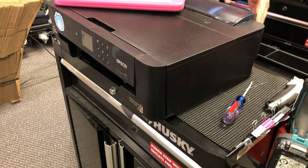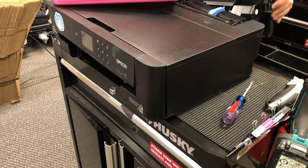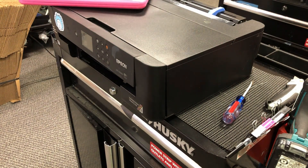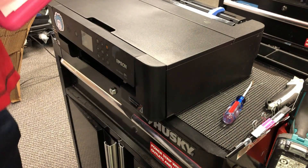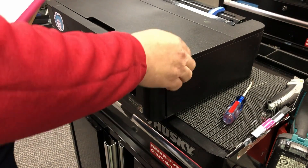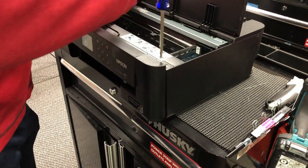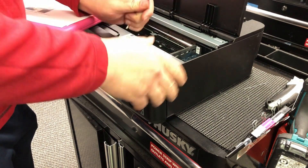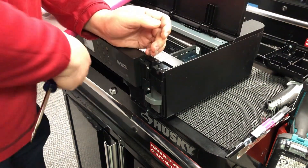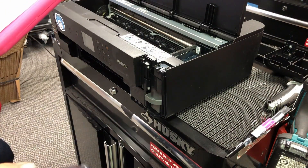Number one is HFR. We remove the paper tray and we remove the duplexer. Now we're ready to remove the HFR. Lift the printer cover and on the right side, if you look straight down, there will be one flat screw. Just use a flat screwdriver — don't remove that screw, just loosen it — and the housing can be lifted straight up.